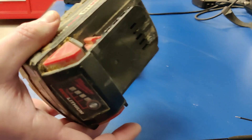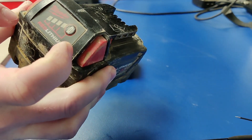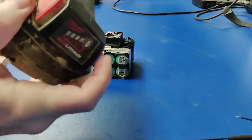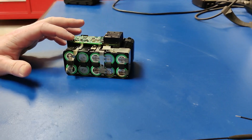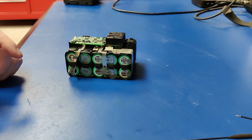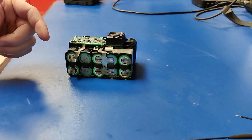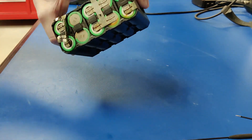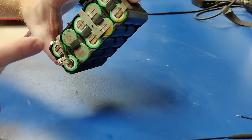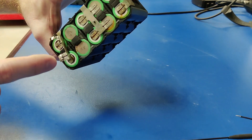I got a pair of these coming in looking just like this, all covered in mud. The red lithium FUEL bar is actually showing the level of mud inside. This one's completely dead; this one had a one-bar flash — it turned out bank four was dead. They wouldn't recharge, and I've already installed the new cells. I've already taken the Dremel and cleaned the old bus bars.